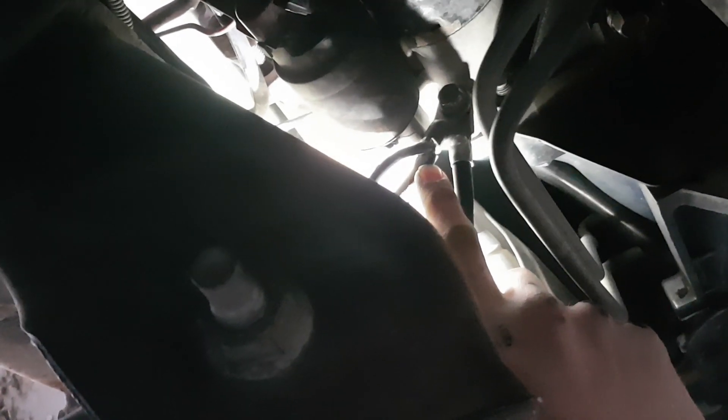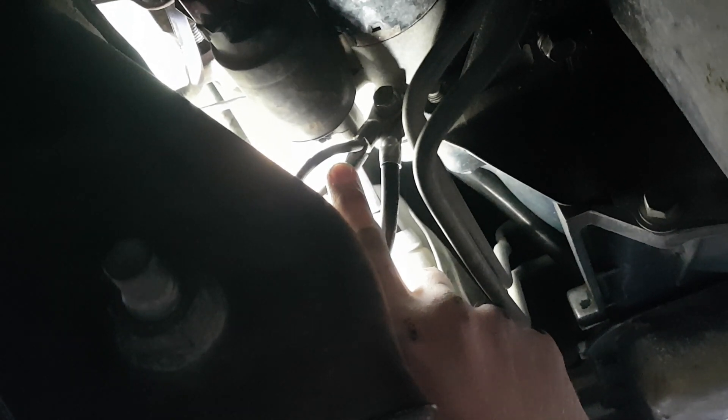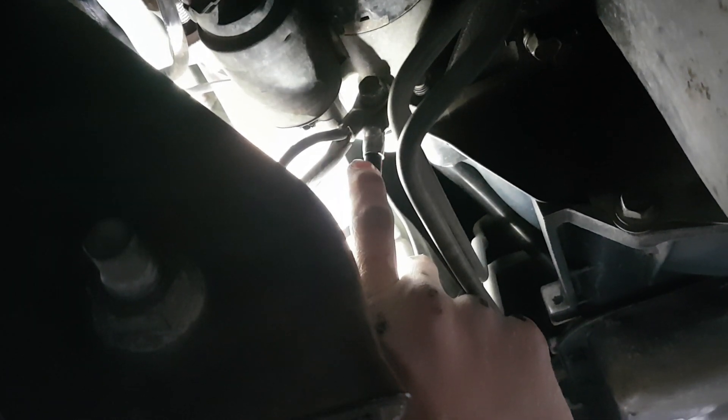This is my new line right here. I went ahead and reused the old one, connected the other ground that I just showed you that's in the wheel well, and ran the other lead to that other ground at the top — so I didn't have to run all the way to the battery. It doesn't actually need all that extra grounding, but more grounding is always better than less. A lot of people have grounding issues with vehicles and trailers.